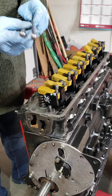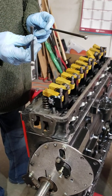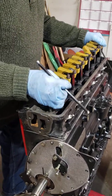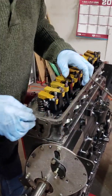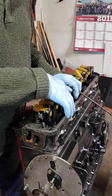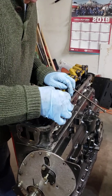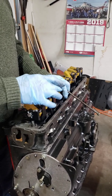Also, your pushrods — the stock pushrod, which we're not going to use, is barely under a quarter of an inch thick. Your Cro-Moly tubular pushrod, which is also a quarter of an inch shorter, is 5/16ths of an inch thick. What's going to happen when you put your pushrods in to the lifter and go down, you're going to find that the pushrod is going to rub against the cylinder head. Shine a light in there, turn the valves over with your camshaft — it's not connected to the crankshaft — and find out where the racing pushrod touches the head.